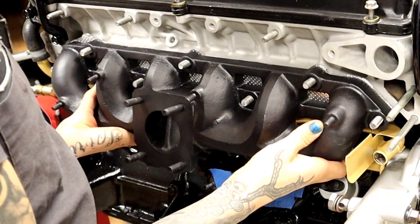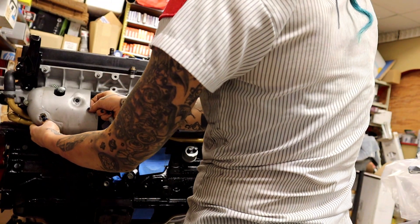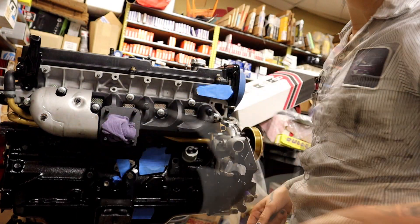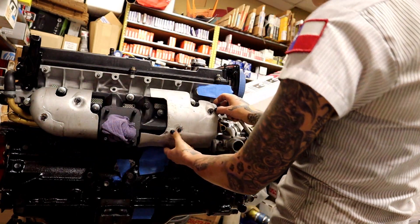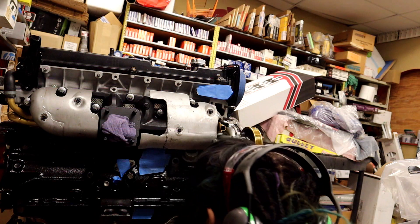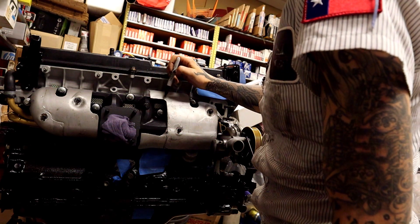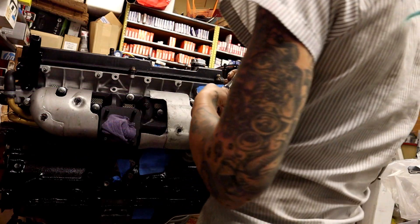On that same note, I'm on a mission to keep everything as cool as possible and control my heat really well, so I went and found my factory exhaust heat shields. However, I had taken them off before and not put them back on because it's really difficult to get to the manifold without pulling the turbo first. So I ended up modifying the heat shields — cutting them so I'll be able to access and install them even when the turbo is on, without having to drain the coolant, disconnect the coolant pipe, take the turbo off, and then pull the exhaust manifold. What a pain in the butt.